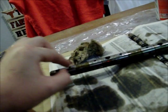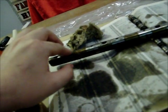This one's actually got some wear inside of it, and this appears to be the only one - well, actually this one's got some wear too. But the engine's got 180,000 to 190,000 miles on it. You can see inside there where it's wearing - that's the other side of this - and there's an oil port there with a little slot. That allows the oil to seep out and coat the rail here with oil, so that when these move up and down they don't have much wear.